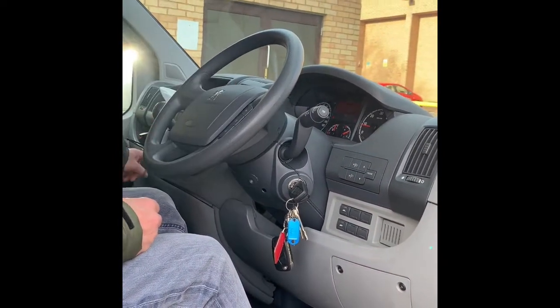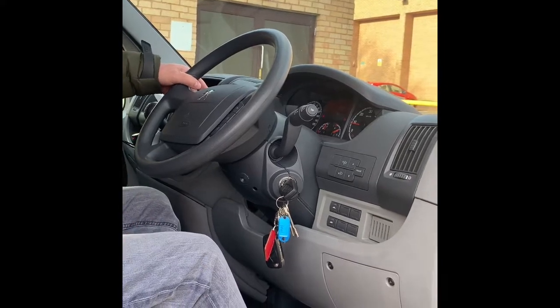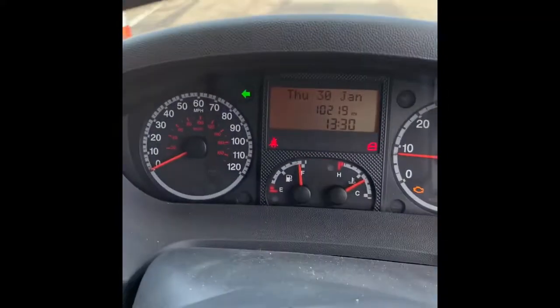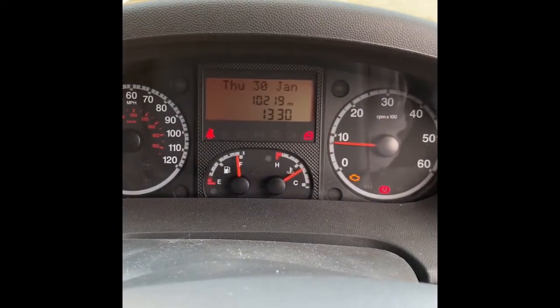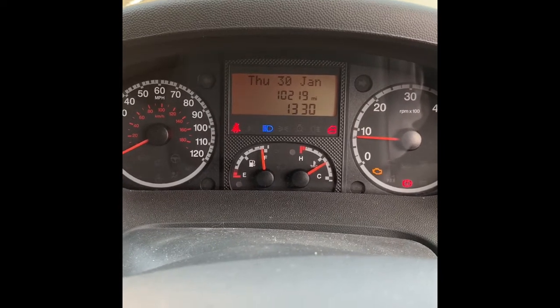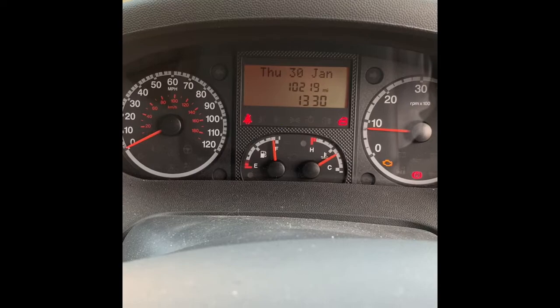and then switch all your lights off, including the hazards, and then check your indicators. And you should see it flash left and right constant. That's flashing constant left and right. If it flashes really quickly, it means one of the indicator bulbs is gone. And then that's your high beam, where the blue light comes. It's the left hand stalk, you just pull it towards you. And that's checking the seat belts on the passenger side.